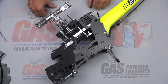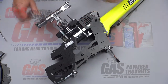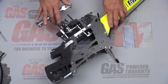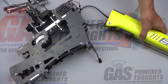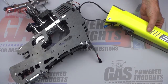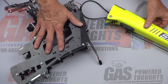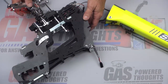We're going to start this step off with the remainder of the donor model which we hadn't taken apart already — the main chassis part and the tail boom. We're going to start to dissect this and take the parts we need from the donor model and add in conversion parts to get where we need to go. Go ahead and remove the tail boom as you normally would and set that aside — we'll use it again later. Most of the work we're going to do here is with the main chassis. We're going to separate the upper plate from the lower frames, then disassemble the lower frames and replace most of the parts with pieces from the new conversion.